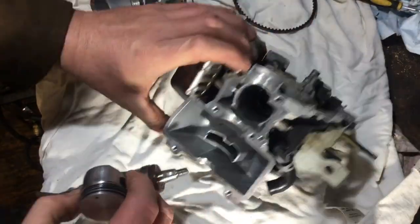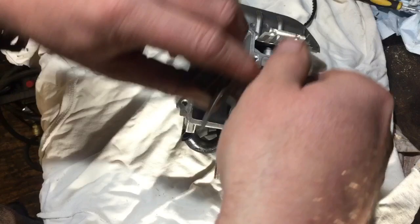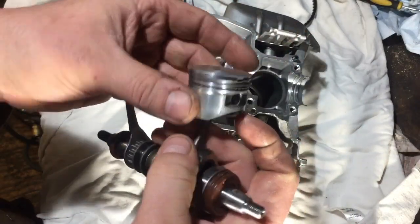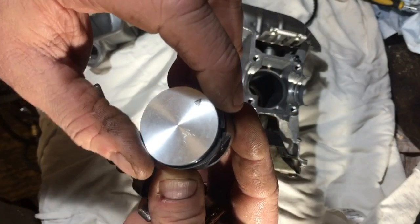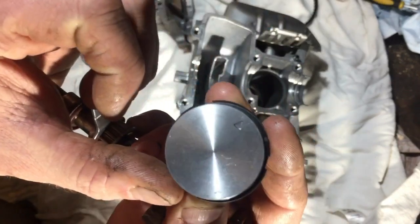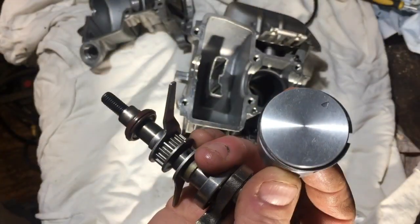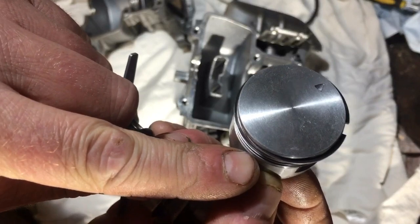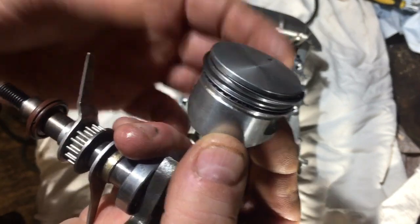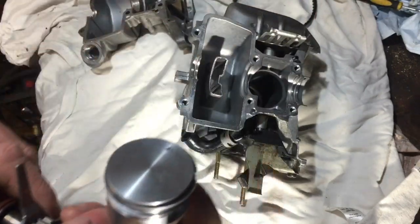What I did, I researched a little bit. I put the piston in so the arrow is pointing towards the carburetor side — the inlet side. I positioned the rings with one gap there, the next ring gap there, staggered. With the oil ring I just put the gaps behind. I staggered the two thin rings because I don't think it really massively matters — there are no ports for it to go past anyway.